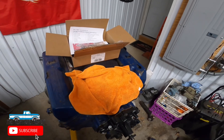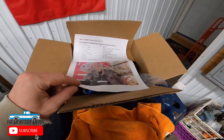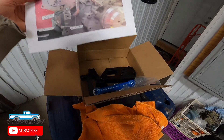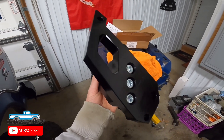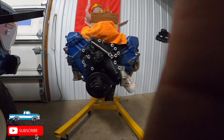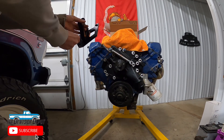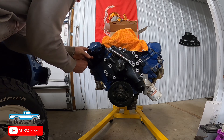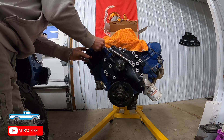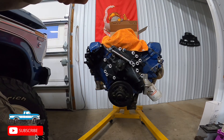I want to move from the rearmost brackets to the front just to make sure I have the most space. I think it makes the most sense to start with the AC compressor bracket. This is really simple — you just want to assemble the bracket first. I'm not torquing anything per the instructions yet because I'm going to take it back apart. Now that I have the bracket assembled, it's just three bolts that go together — really simple. It goes onto the engine like so, with three bolts: one is 7/16ths and the other two are 3/8ths. Very, very simple — not difficult to understand whatsoever. Very good design so far.